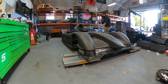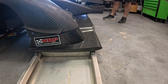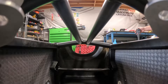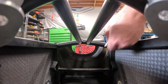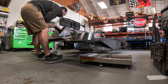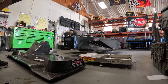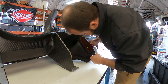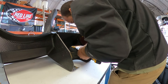My toughest battle about this whole process was keeping the front end of the diffuser perpendicular to the frame. This is something you're just going to struggle with, and especially when you're drilling the holes to locate the front diffuser, start with small ones and slowly get bigger. Back to some paint on a Q-tip because inside these bores there are threads, so I couldn't just drill straight through from the outside. Putting some paint on the inside allows me to make sure that I properly located at least my best estimate of where the hole is. We're going to start off by drilling with a very small hole and then open it up slowly to get to the final diameter — hopefully not needing to slot. But of course I absolutely had to slot two of my holes.